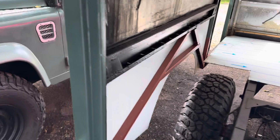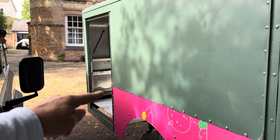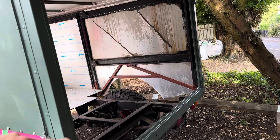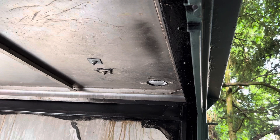In that gap there's going to be a door, so there's going to be a window on this side, a door there, and then a window in the front, plus a little portal on the back. On this back panel I've got to put strengthening pieces across to reinforce it, because that's too big a span for one sheet of ACM. I've also covered up my vent patches — I've taken out the swinging-type fan vents and put a patch on top.